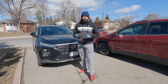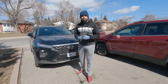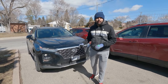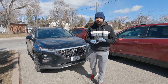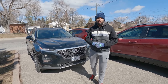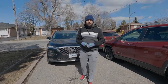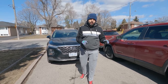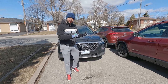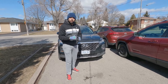Hyundai's owner manual recommends changing engine oil every 6,000 kilometers, so if you have a brand new Hyundai your first oil change is at 6,000, then 12,000, 18,000, and so on. Changing the engine oil takes approximately 30 minutes and it's very easy. You can buy the oil and filter in advance when there's a deal at your local automotive store — it will be way cheaper. I'll put links to the required tools, engine oil, and filter in the description below. Thank you for watching — please hit like, share, and subscribe so you don't miss any upcoming content. See you next time!